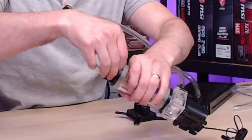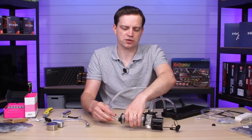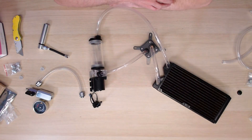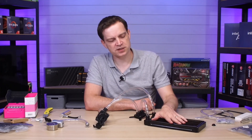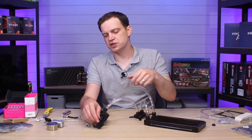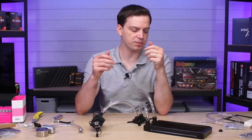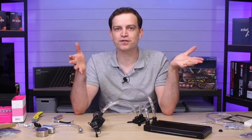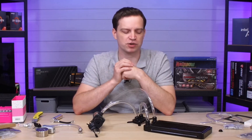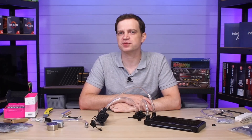With the system tested, there shouldn't be any leaks — though this is just a proof of concept and we do need to fit it into an actual system, which is coming soon. Once it's in a real build we'll add water, which is the real leak test. We still need to fit fans onto the radiator, and I've got information from you guys on how to power them via three-pin and molex connectors. In essence, this is our first complete custom loop — though we'll only count it when it's running inside a system. Subscribe to the channel if you want to follow along!